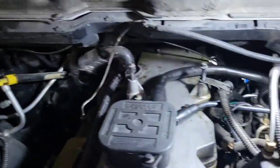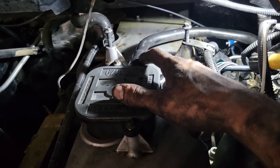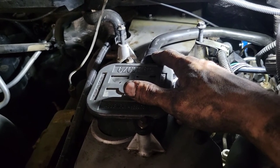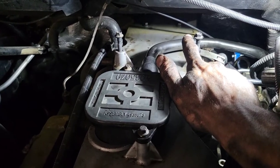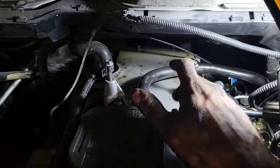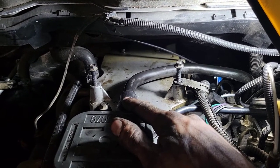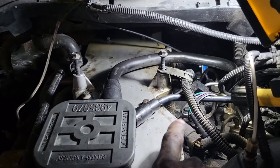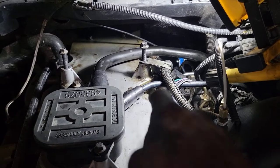While I was investigating this fuel line, I found something else wrong with the truck. This line is your crankcase drain and this one is your crankcase breather — one spits it out to the environment for emissions, and one goes back into the motor. When I took this cover off, you can see it's yellow-stained and there's oil puddling on top. There are plenty of videos on this but I'll still make one because they don't show you where these hoses are. The only way to get the bushing is to order the whole new hose — about 30 bucks, not bad. I ordered both. This is leaking and pissing oil — there's oil all on the side. I've already changed the valve cover and rocker cover gaskets twice but wasn't fixing it. Now I finally found it was leaking from here.